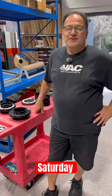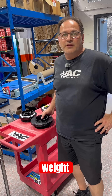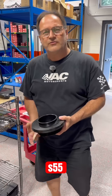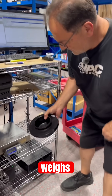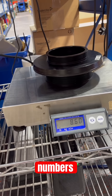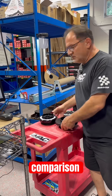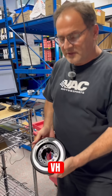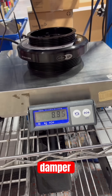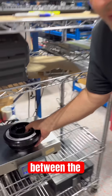Welcome to another VAC Saturday session. In this episode, we're going to talk about damper weight. You ever wonder how much a factory S55 crank damper weighs? We're going to weigh it for you, and you're going to get the numbers — 8.6. Now we're going to give you a comparison to the ATI VAC ATI damper — 8.85. So you've got about a quarter pound difference between the two.